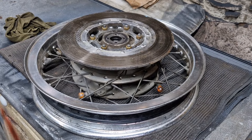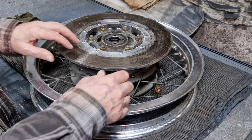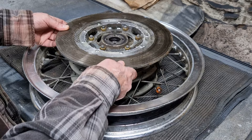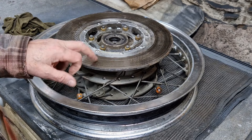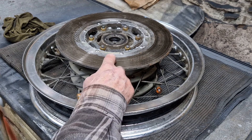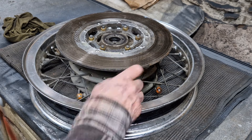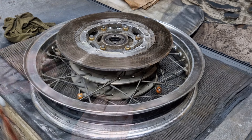We're back in the workshop and now we can see what we've got. First job is to get this disc off — it's only held on loosely at the moment. I'm going to measure it with a micrometer, but I've got a feeling it's going to be below the minimum specification, so I may well be sourcing one of those. Let's get on with it and get it off.